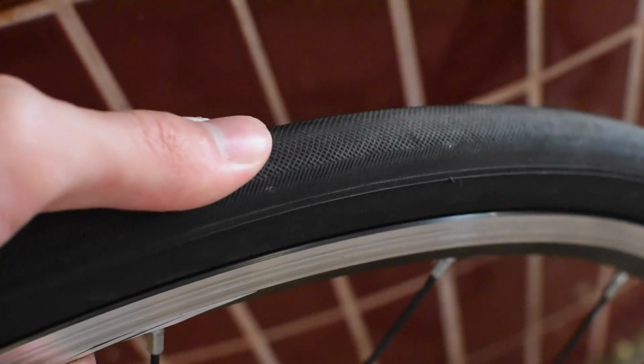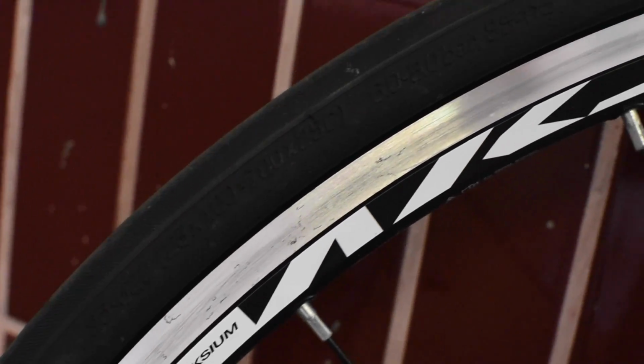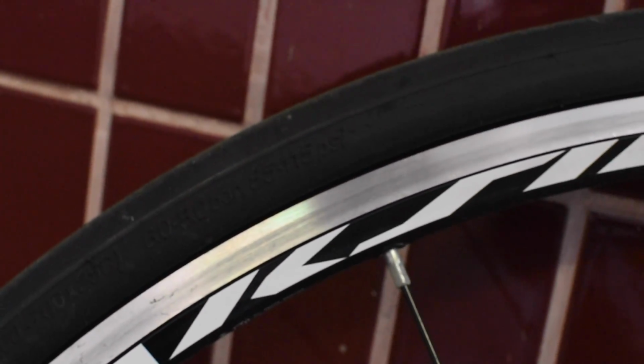In addition to brakes, check your tire pressure. Tire pressure in bikes tends to be lost a lot quicker, and if you haven't ridden in a week or more, check it and make sure you pump it to the manufacturer's specification. However, there is leeway in PSI depending on road conditions. The manufacturer's specification is probably listed somewhere on the tire, and refer to it to have a general idea of what PSI you should pump your tire to.